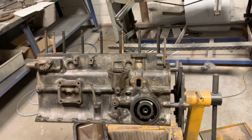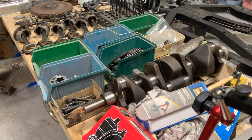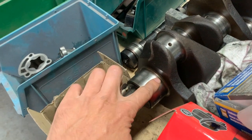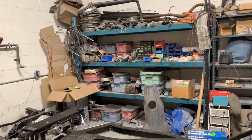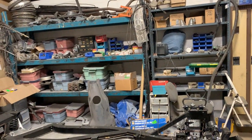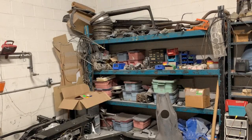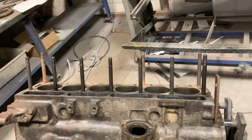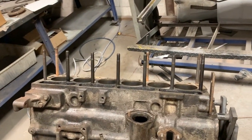Since we need new guides and valves, I think we should focus now on the cylinders. The crank doesn't look very good — there are some marks — and even without measuring I know it'll need grinding. However, we have a spare crank on the shelf from the other engine that I already measured and confirmed is still at factory standard size and within tolerances. So we'll use that crank. That's going to happen in the next video — it's a whole new topic. Thanks for watching, commenting, and subscribing, and I'll see you soon with more episodes of the Rusty Buses.